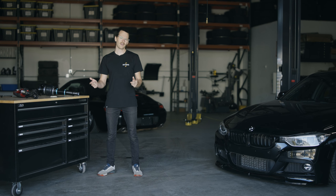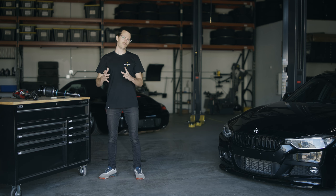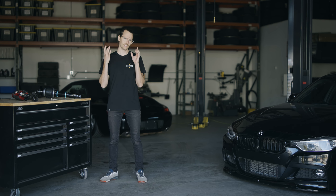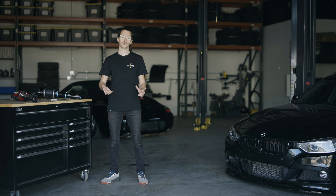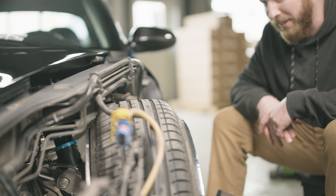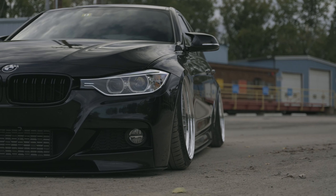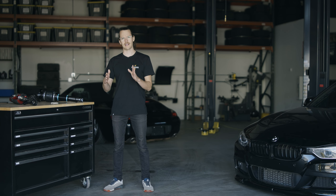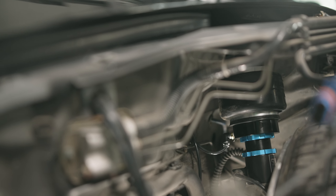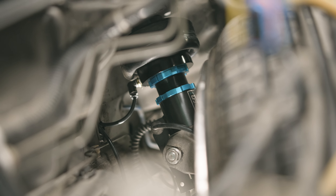The next common air ride issue is relatively easy to avoid. Say you've got your build up on jack stands — what you're doing is verifying your wheel fitment. You've got your air ride on, your car can go all the way down, and you want to actuate that suspension upward to get that perfect offset dialed in, select the right tire size, dial in your camber, and this is the perfect time to check your tire to bag clearance — something very important, otherwise you'll end up damaging your air springs.